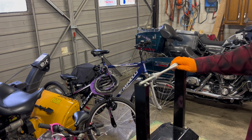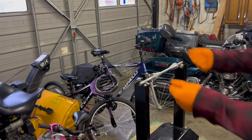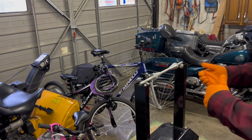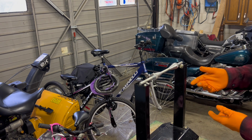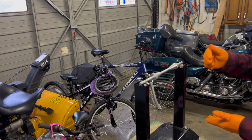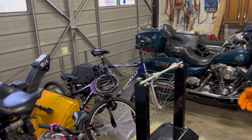Again, some people, if it's real bad, like you're putting on a lot of weights, guys will break the tire down, move the tire 90 degrees, and then retry it. Again, there's that marking on the tire we had. It was yellow. They want that over top of the valve stem. We did that, and here we are.